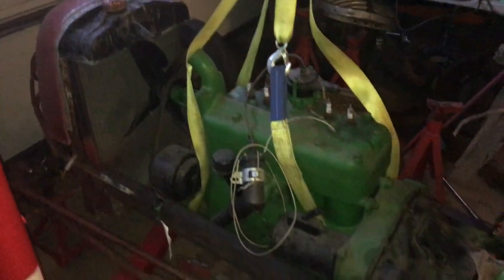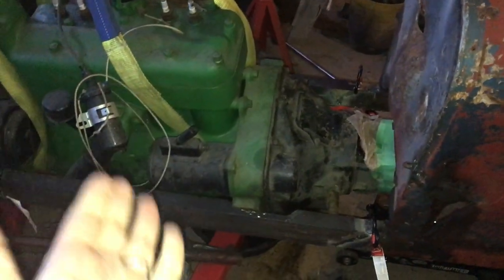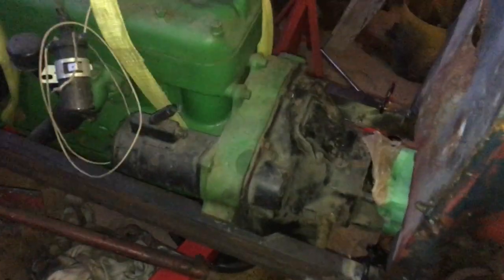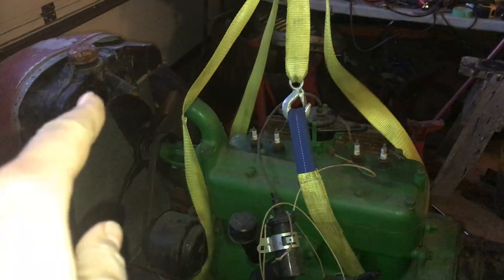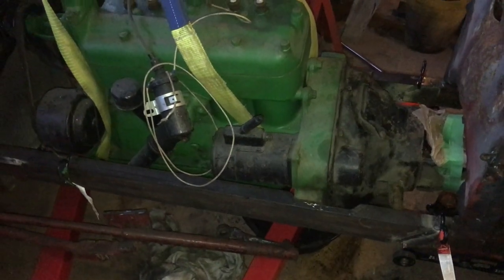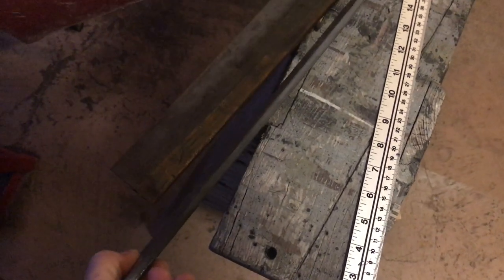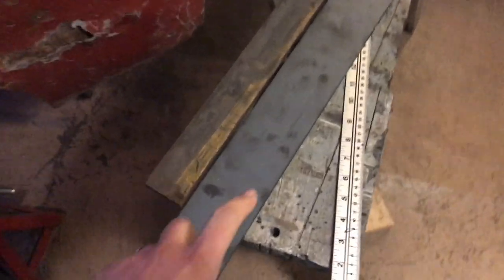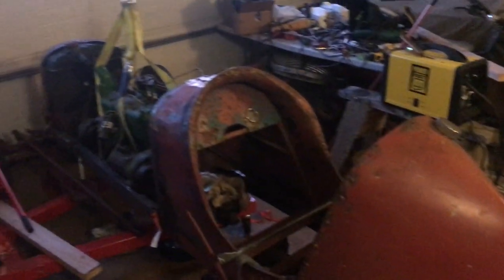So with the engine more or less in place, we have to get it at the right height so that it lines up with the rear end and the drive shaft isn't gonna be at a crazy angle. We've had to notch the frame so we can put an engine mount and then fish plate it in. Right now it would clear with the hood going on top, so we're gonna start mocking up the brackets, the engine mounts, and start getting that ready. For this we picked up some raw steel — good thick heavy gauge steel — that can be cut down to length and used to make our engine mounts, then drill the holes through to the engine.